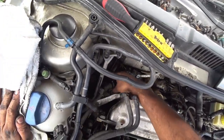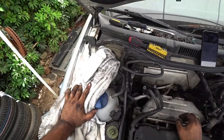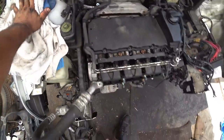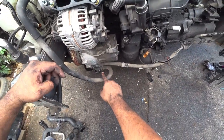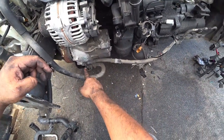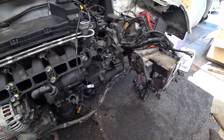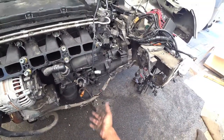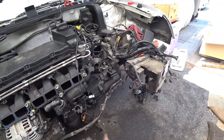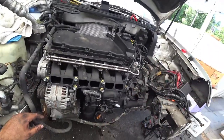Nothing else is attached to the car. These are just coolant lines — those are not attached to the engine itself. Same with the power steering line — it's not attached. Just make sure you unbolt it from here or just take off the clamp. Same with this one — unbolt it with one 13, there's another 13 down the side. That should free everything up. Then remove the pendulum mount, aka dog bone. And then you got your two motor mounts, a cherry picker, and pull this sucker out.